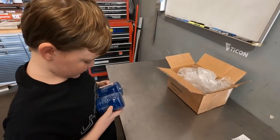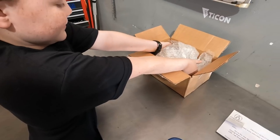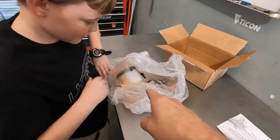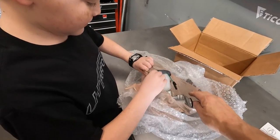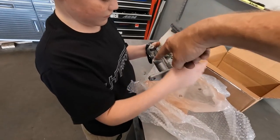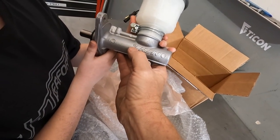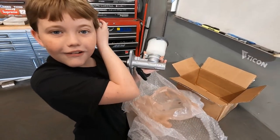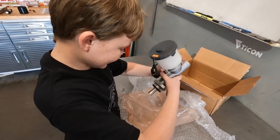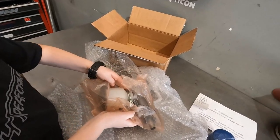We've got two oil filters, which is what we're going to use today — we'll need one for the HF motor. And this is the master cylinder right here. I used to be into CRXs so much back in the day. The Civic EX was the only one that would bolt to a CRX, and it was the bigger master cylinder — it's a 15/16. If you look on the aluminum side, see this? This is the size — 15/16, that's almost an inch bore. This is a very strong master cylinder. It's going to give the brakes a really nice feel. This sucker is brand new. This is such a rare part.